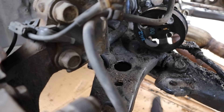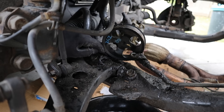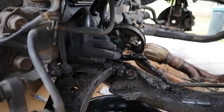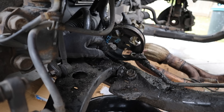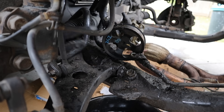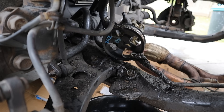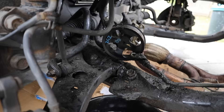I'm also going to be replacing the control arms because the bushings look shot, and the sway bar end links are pretty loose as well. Now is the perfect time to replace your control arms because normally there's that big engine mount sitting right on top of here. You can see all the oil from the timing cover leak has deteriorated all the rubber on the control arm bushings. There's just two bolts over here and one bolt and nut at the back, and it should come right out since I've already disconnected the ball joint to get the CV axle out.